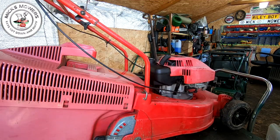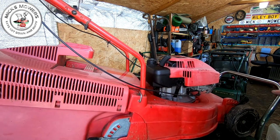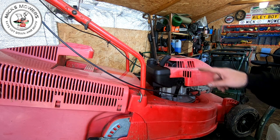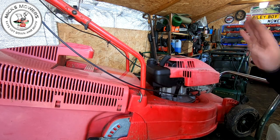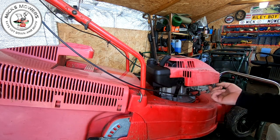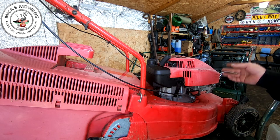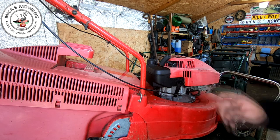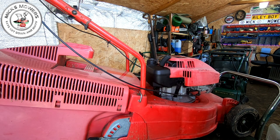Just finishing off on this — what I'd call a Ferrari red Tecumseh lawnmower. What I decided to do in the end was take the little grub screws out and drill through the pull cord casing — now that's on there with no problems. It does look better with it. A new spark plug, air filter's been done. I've cleaned all the engine off with some gunk off and compressed that all off. I've got to put some oil in it now. Blade's been done. So that's about it.